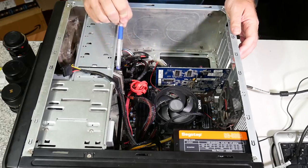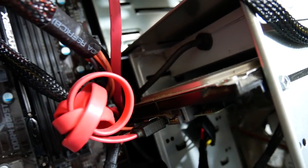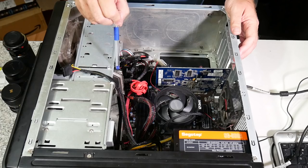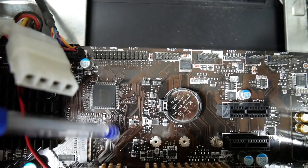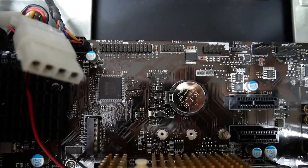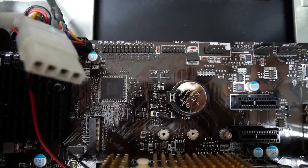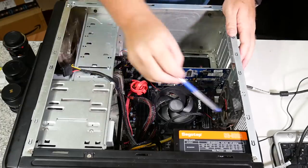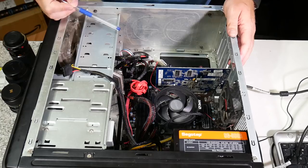And then if you notice here, there is a fairly old 3.5 inch SATA drive, and we're going to get rid of that completely. We're going to install an M2 module — a 480 gigabyte solid state drive in the M2 slot — which will be our boot drive for Windows. Obviously we'll also tidy up the wiring here and do some cleaning and things like that, but that's basically where we're at.